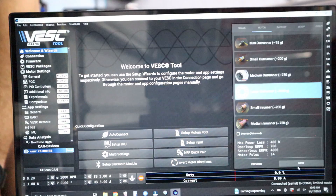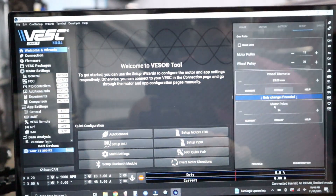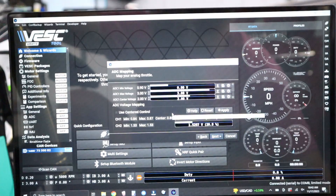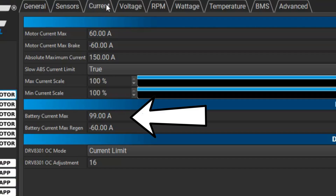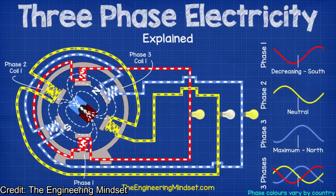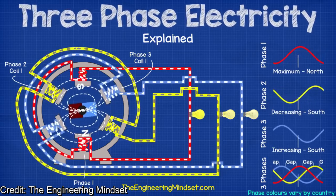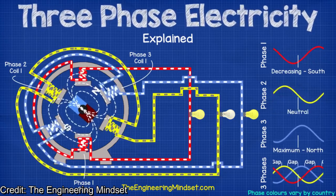If you want a full wiring guide in depth, leave a comment down below and I can make a separate video going into that. Now let's talk about programming, because these controllers are not plug-and-play with your e-bike motor — they will need to be tuned out of the box. When I say tuning, I mean using the motor setup wizard to read the configuration of the motor, then mapping your throttle to the correct ADC channel. After that, you'll probably want to customize the power output settings by tweaking the maximum number of amps you can pull from the battery and playing with the phase amps.